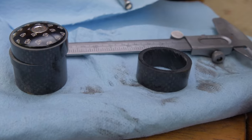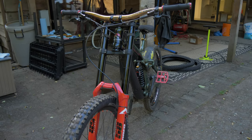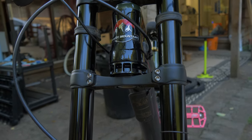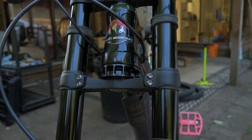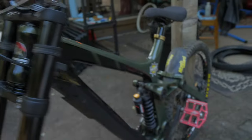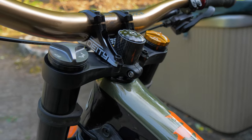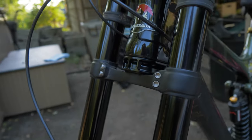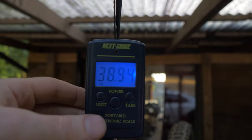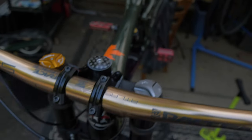I don't have room for those spacers under the crown anymore — the lower crown was never moved, so the travel of course is all the same. It's just that the upper crown had to be raised up. With the axle getting lowered by about three quarters of an inch, it's offset with the cup, and in theory the frame is in the same position as before, keeping the geometry exactly the same. The stack height is a bit lower because the upper crown is now all the way against that headset, but I can change that later. My honest thought: I think this is gonna feel better on flow trails, so why don't we take this bike to Whistler and actually test that out?